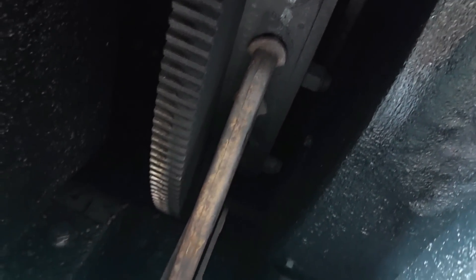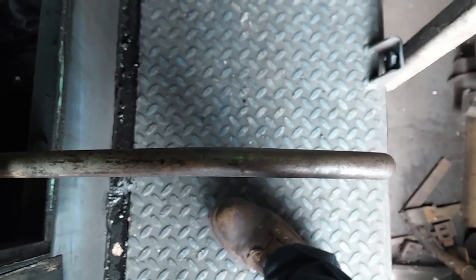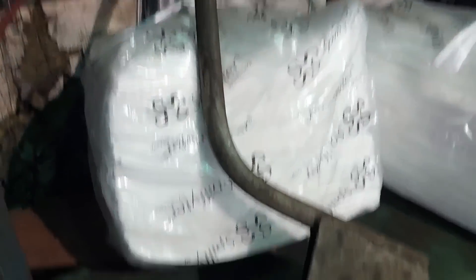This is how they move the engine crankshaft up there to bolt the air compressor up to it — to get it to line up. Down there there's another piece that goes in there, so there are actually two things that slide into those holes around that flywheel. Then you just push this down and it moves the whole crankshaft. Here's the tool — this is one we had in our shop here, dug it out so you could see it a little bit better. It has two arms on it, and those go in those holes. Then they just push down and it turns the crankshaft. That's pretty neat, and actually it turned pretty easy.